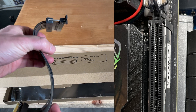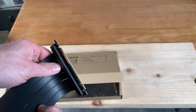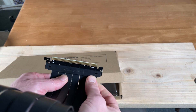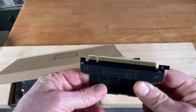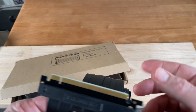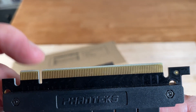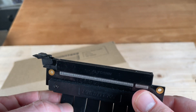How would you know what cable you need? Take a close look at your motherboard. The length of the actual cable is considerably less than 300mm — the published length includes both plugs. There is a lot of mystery regarding the riser cable, but essentially it's an extension cord for the graphics card. It gives flexibility to your design.